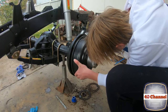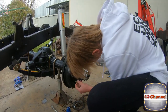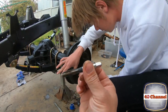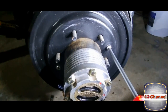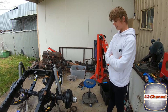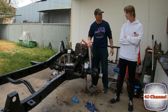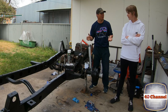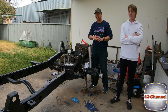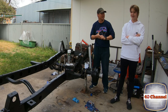Jack's putting the brake drum on, lining up the two locating support holes. The bolt is an M10 by 1.25 — we cleaned out the thread with a tap first. Looks sensational Jack — throw the tires on and we've got a roller again! We're nearly up to another rolling chassis — just throw the two front tires on and we're done. But just like last time, it won't be rolling for long because the back tires are coming off next to do bearings and brakes again and check all the rear assembly.